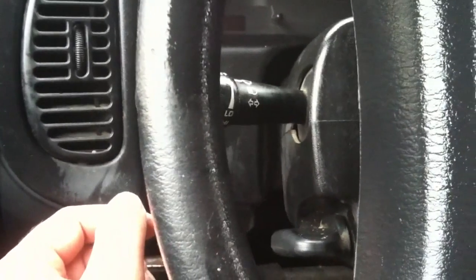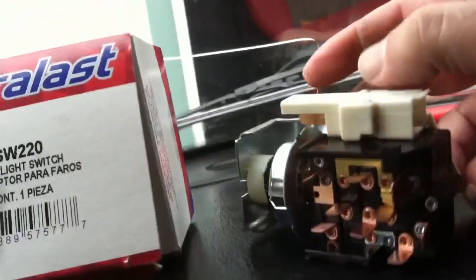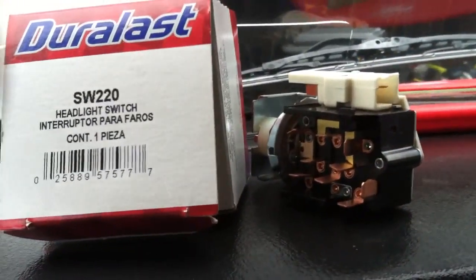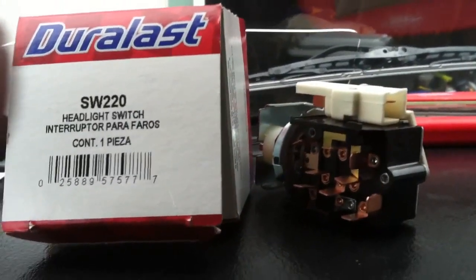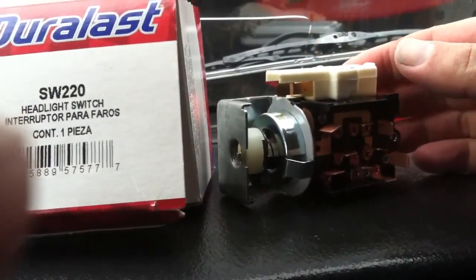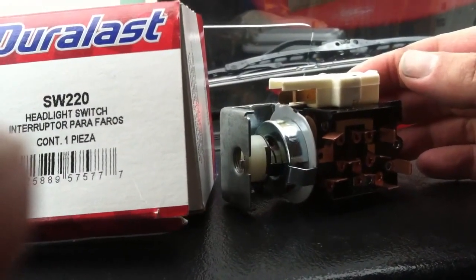This is the dashboard. We cleaned it up a little bit for the video. We determined there's a problem with the light switch — basically on this truck, you pull the light lever and your headlights may or may not come on. The reason is this is a pretty complex switch with a lot of stuff inside, because many other things get turned on when the headlights are on — that's what all the other connectors are for. It's a fairly high-amperage switch with moving parts inside that wear down. Generally speaking, it has to be replaced as a module; it's not internally repairable.